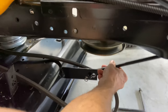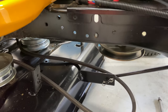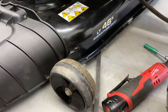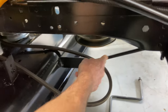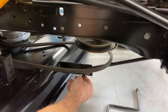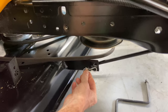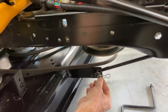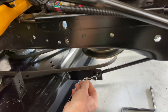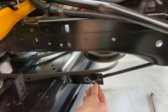Since we're in the front here, we're going to take the front rod off the mower deck. It is tight right now, and that's why I had the pry bar. If you slip the pry bar underneath the mower deck and lift up a little bit, it usually makes it loose. That'll make your rod much easier to come off. This is a bow-tie butterfly clip. Make sure when you put them back to put them back forward to rearward so they don't pop out — we do 90% of our driving forward and 10% backwards.